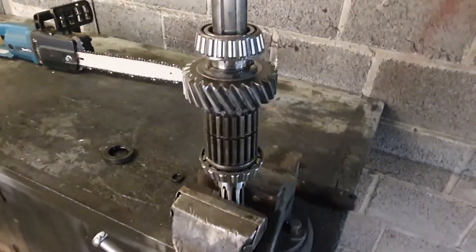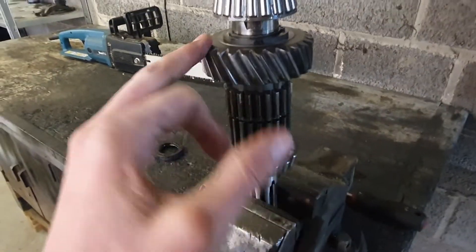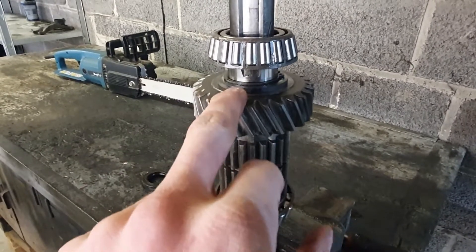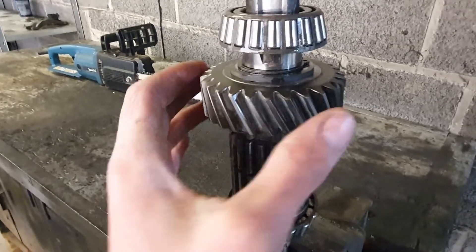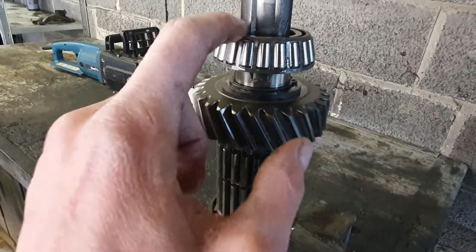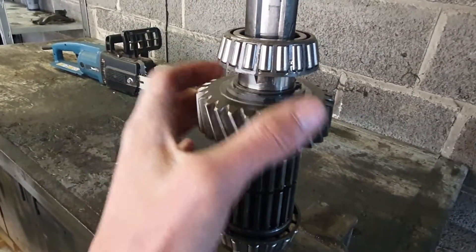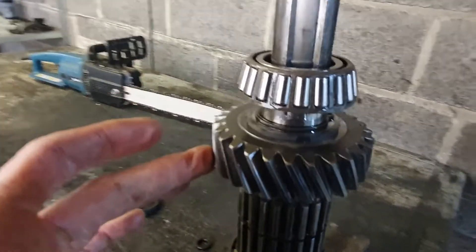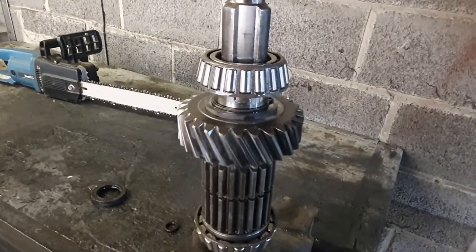Well I've got it all apart again. I had the gearbox - it just had to come apart completely. It's quite hard getting this bearing off but it's not the tightest to fit so that's all right. I tried the old gear and the old thrust washer. Apparently it worked, but we didn't really change from high to low - we just drove it up the road and that was it. Put the circlip back on, hammered the bearing all the way home and there's a clearance. I can check it - even with that pushed against the circlip there's still a clearance. So I tried it with the new gear and I'm going to reassemble it because it's working, so I can only assume there's a bit of dirt on there or something.